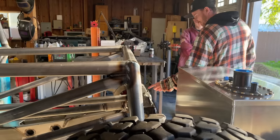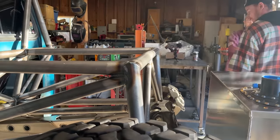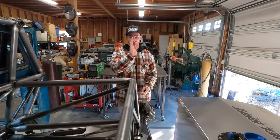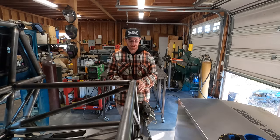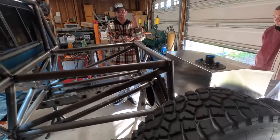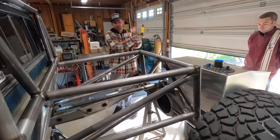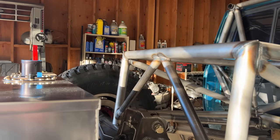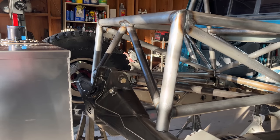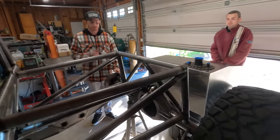One thing I also noticed is this tube is kicked off at an angle. The reasoning is with the bump stop landing in the same plane — the bump stop is going to land off this tube — you want your bump stop angled forward because your axle is swinging in an arc. If your bump stop is straight up and down and your axle is swinging in an arc hitting it, the bump stop is scrubbing across the pad on the axle. In this case, the angle means when the axle swings up to hit the bump stop, it's landing in the same spot and not scrubbing — it's more in line with the motion.